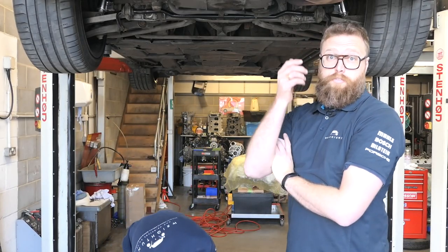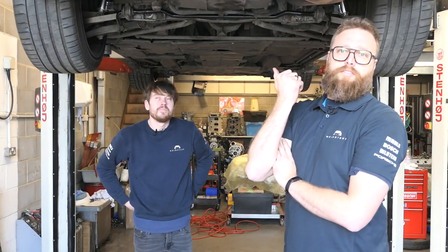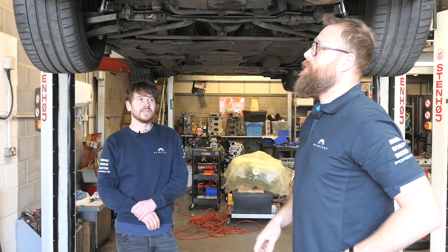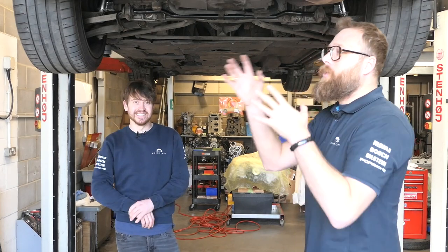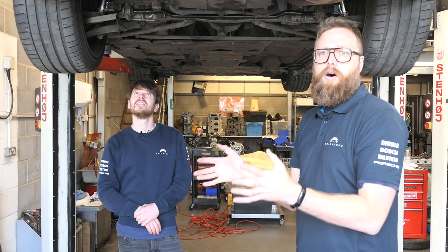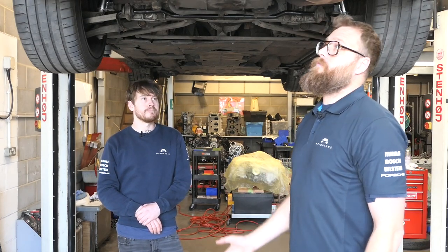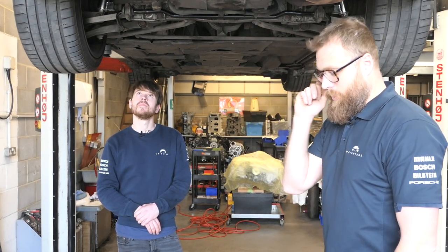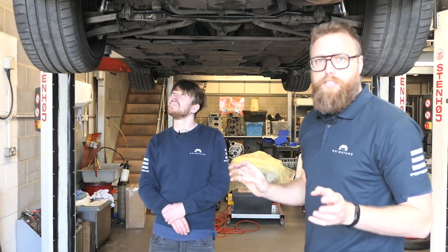Joe made a good point — we don't want to be negative about this, because it's obviously a step forward compared to a trailing arm. But when they're older, you've got a lot more bushes — on a trailing arm there's two bushes, but on this there are 6 to 10 bushes per side. If they're all worn, your toe and your camber could be changing quite a lot, which is going to make the car very nervous. And on a 911 with all the weight in the back, that's a bit of a disaster. Every single arm change has made such a big difference.